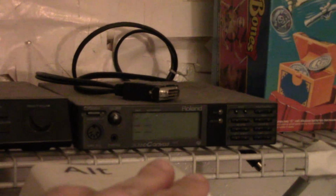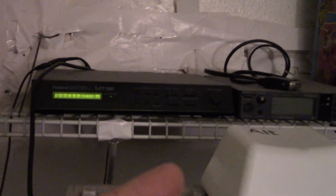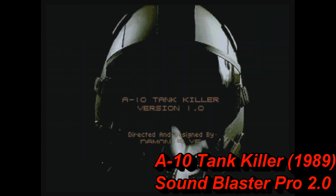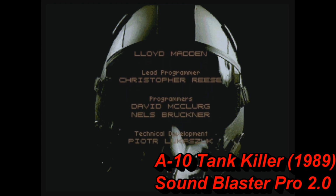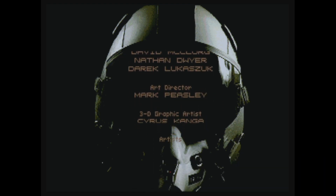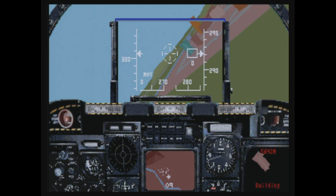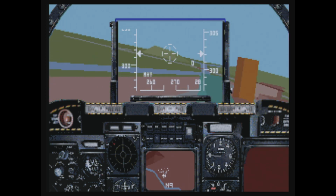So I was a little worried at first, but I've actually compared speeds with my regular 66 megahertz 486 that also has 256K of L2 cache. And this machine clocks a little bit faster with the same benchmarks, which makes sense because if we're running in write-back mode on this machine, it should be a little bit faster, and that seems to be checking out with the benchmarks. So I think it is running, but I'm not sure.